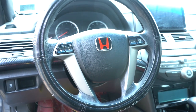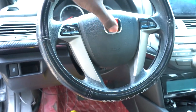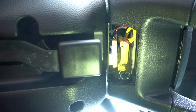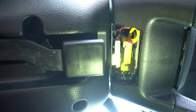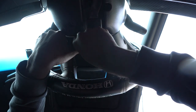I have to disconnect the power of the airbag - the explosive part which is the center right here. The connector is on the bottom and I'll show you, and there's another connector to show you as well. You can see that bottom part - that's the airbag connector and it has to be disconnected for you to take out the center of the steering wheel. You've got to be very careful. Pull this part back and then gently pull it out.